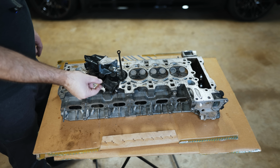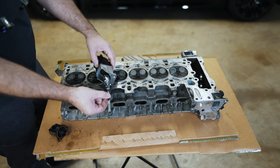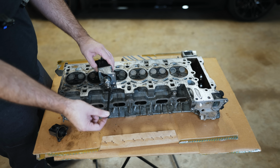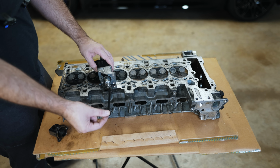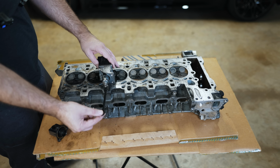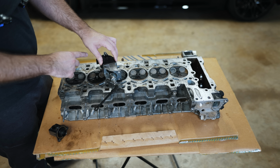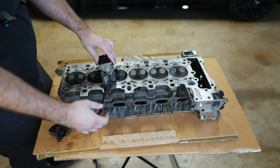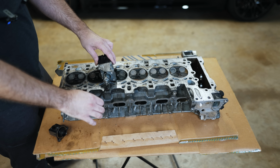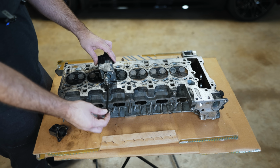So if you have an N55, the DME will control this pretty easily. It's self-explanatory. But if you're relying strictly on the valvetronic and the electronic wastegate to get rid of the excess boost pressure, and you've added another 8 PSI plus way more flow, then that whole calibration has to be redone by a really experienced tuner. So you're at their mercy with regards to skills on bleeding the boost out of the system if you've changed from the stock parameters. And that can be an issue if you're running really high boost or you're upgrading your turbo. So rather than deal with the potential headache of blowing your turbo up because your tuner just didn't get the data logging right or whatnot,